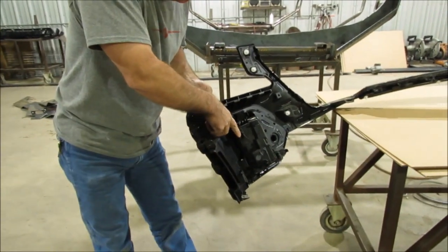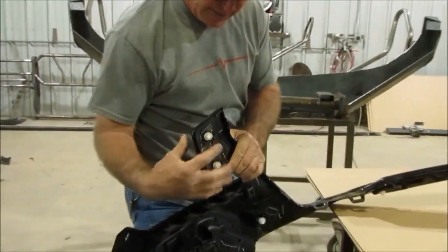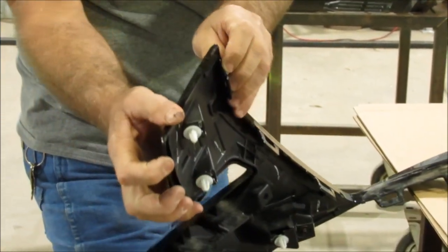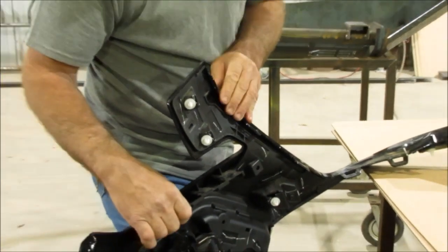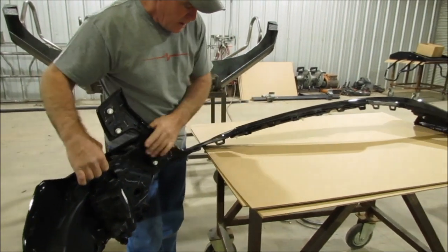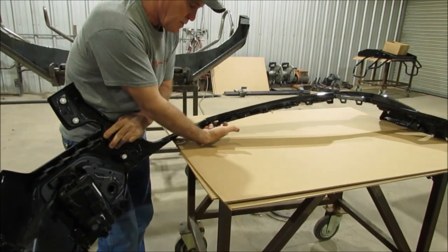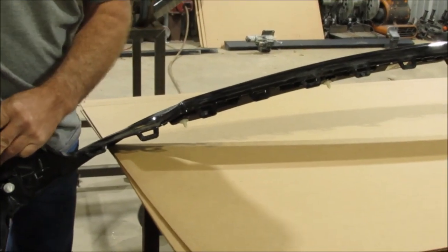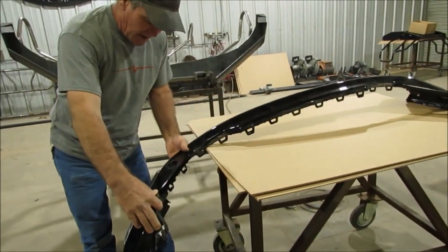There's your fog light that was plugged in right here. That one little glass piece at the top, this is the little eyelets. It's got all these little snap-in things there, but that's the one that's got to pull straight forward to come out, okay? So you're seeing what you got to do now. And these are all the ones that I say when you reach through the grill. I reach through the grill and you pull up on that little thing, because when it pushes in, there's a little catch under it. You lift up on it right there, and you just keep working it out one by one like that, okay? But that's what you got to do to get that off.